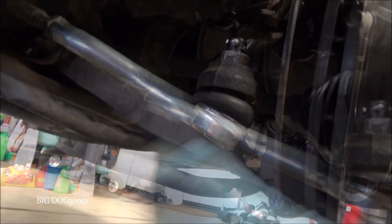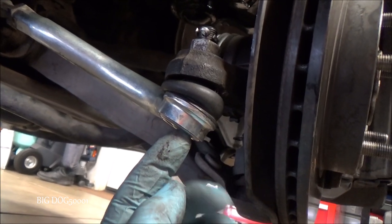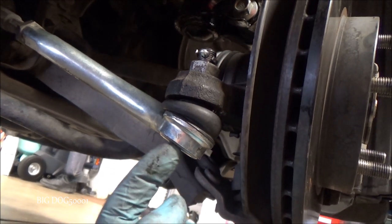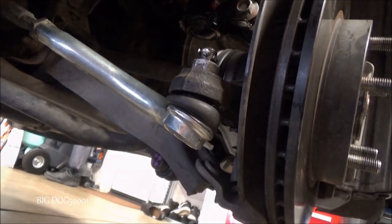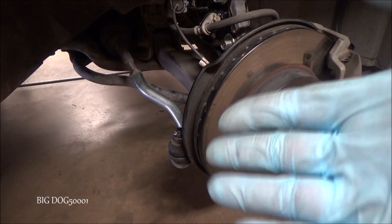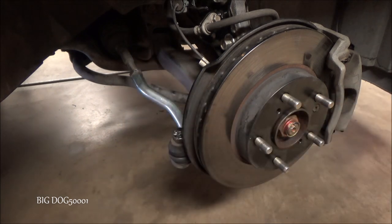There's the final shot. We've got a brand new cotter pin, the nut tightened down to 40 foot-pounds, and the jam nut tightened up — we're good to go. Note that these genuine Honda outer tie rods don't have a grease fitting — the grease is already in there. If you get aftermarket ones like Moog, you'll need to install the grease fitting and give it a few pumps before installing. Hope you enjoyed how I do the outer tie rod ends on these Civics — if the video helped you out, give it a thumbs up. Thanks for watching!